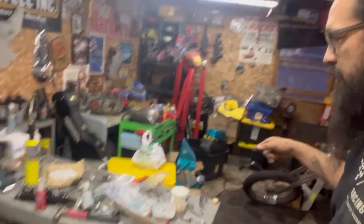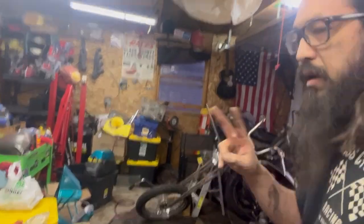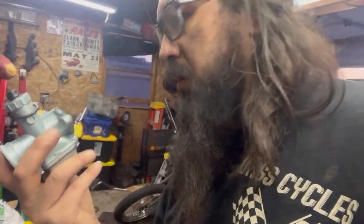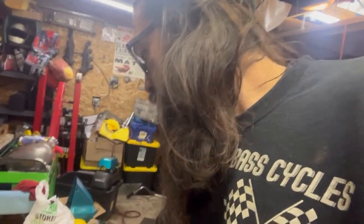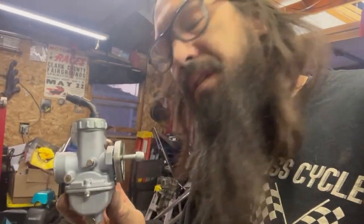Moped's off the bench, so we got a good amount of space here. We got two carb options — we got the smaller one, this is the bigger one, the M20 and the M18. I'm leaning towards remaking a new intake to make this work for the M18. I kind of like the smaller volume, higher velocity approach. Not positive what we're doing on that.